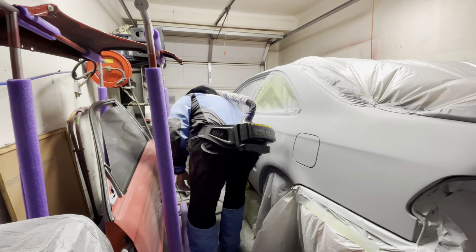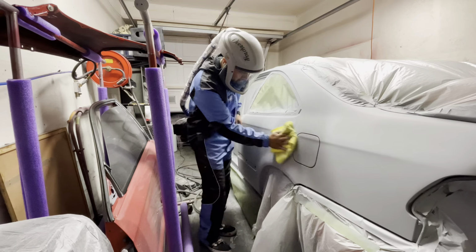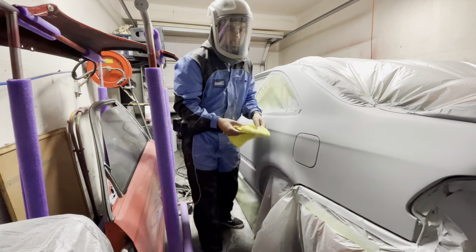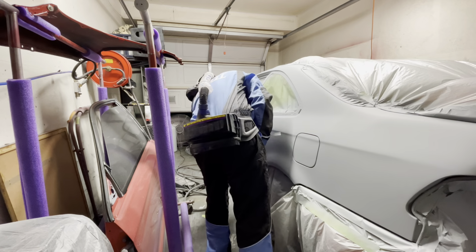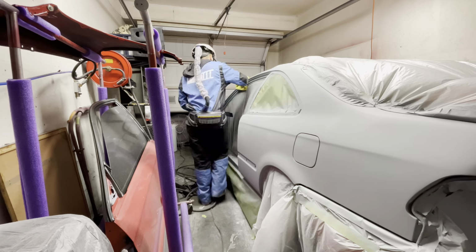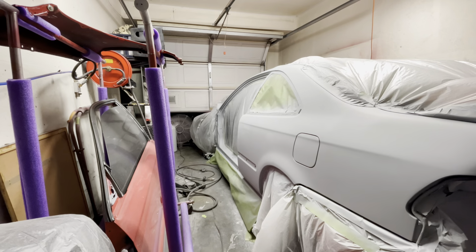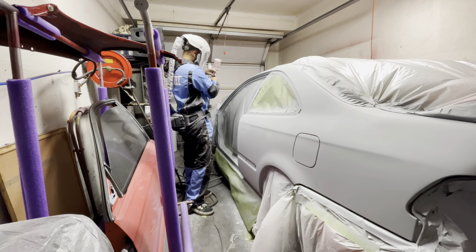After sanding the paint reacted areas, I grab a clean cloth and clean off all the areas, basically all the dust from sanding the primer. I clean it twice. One will be dry and the next will be with wax and grease remover, a very light coat of wax and grease remover, and then let that dry.